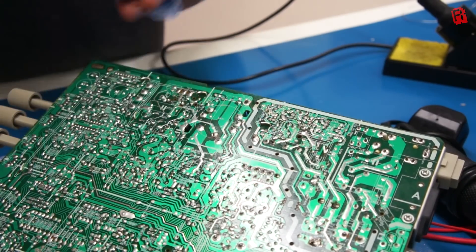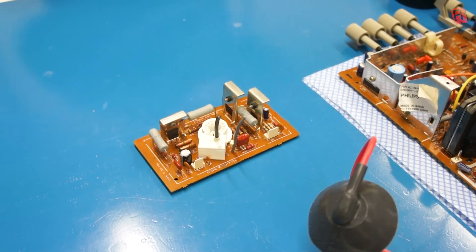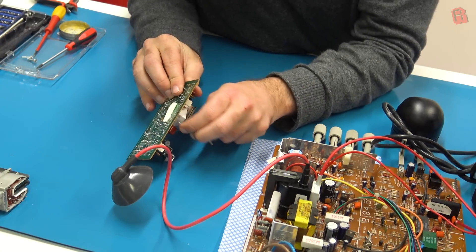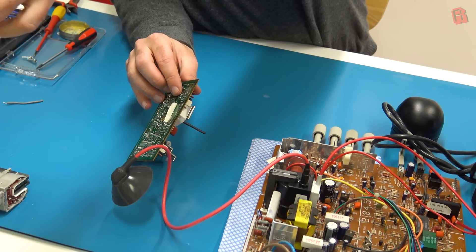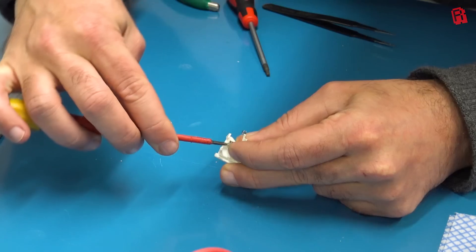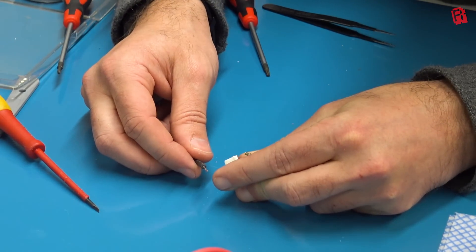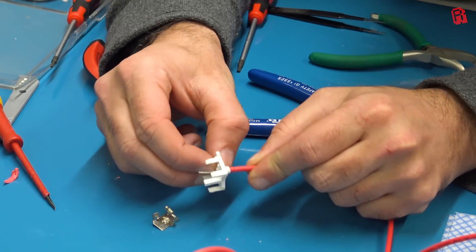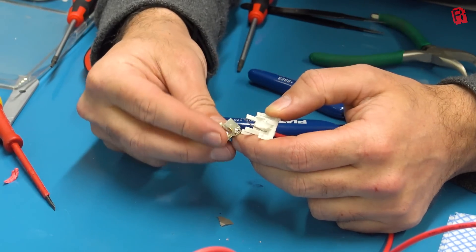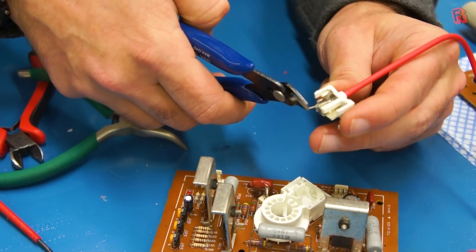The two leads coming from the new transformer now go over to the neck board. One lead is a simple job — just soldered into the board. The other is a little trickier: it feeds into a plastic casing with four tabs around it to pop the top open and remove the cable. This was a real pain to get open — no doubt there's an engineer's tool that squeezes all four tabs easily, but my method involved careful prising and poking with a screwdriver and a scalpel. The cable is not soldered inside; it's just pinched in place, so it's easy to release and feed our new cable into. What you should never do is splice and rejoin the wire in the middle. There's a lot of thick insulation on this wire for a reason — you'll put yourself and anyone else at risk if you trust insulation tape to stop 20,000 volts from hitting you, so please don't splice it.